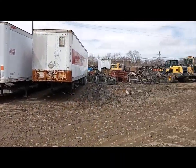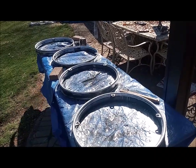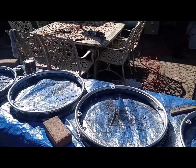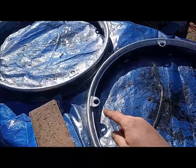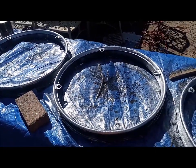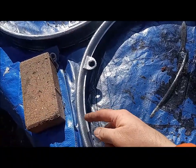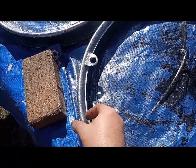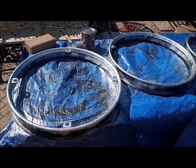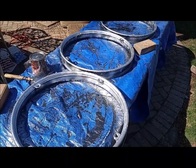I spray painted the silver metallic paint around the edges. One suggestion: it's probably not a good idea to put POR-15 on the outer lip of the rim, because some of it flaked up this morning and if that flakes the paint comes off with it. I'd recommend just doing the inside with POR-15 and leaving the outer lip alone — the other parts are concealed anyway. Now I'm going to wait for the paint to dry and start reassembling.